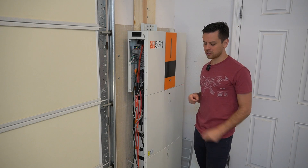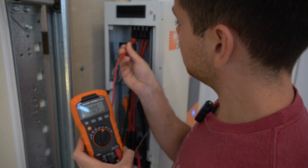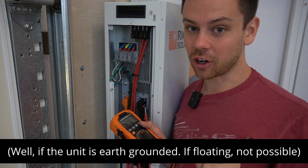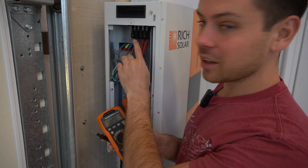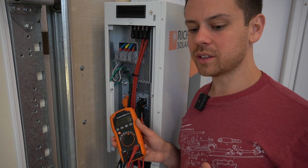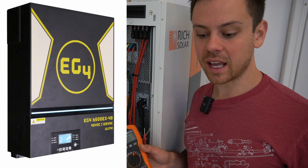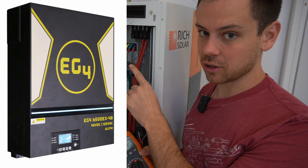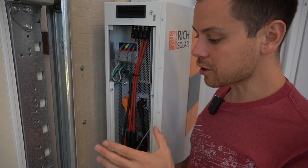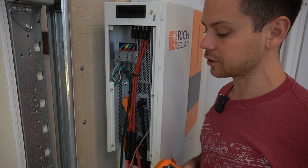Let me show you the voltage at those terminals. With it turned on, we have 100 volts AC at this terminal, and this one, and this one — they all have live AC voltage. It's enough current to kill you. I actually blew out the fuse in my meter and it caused an arc, which melted the terminal. This is a direct AC connection — some all-in-ones have enough to shock you but not kill you, but this one is a direct connection and can really mess you up.